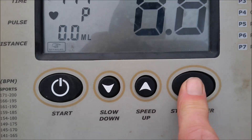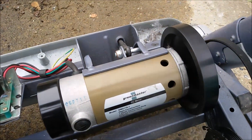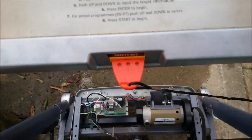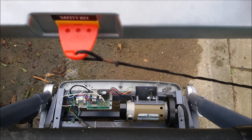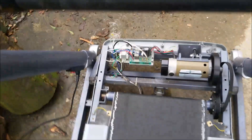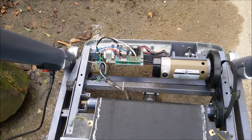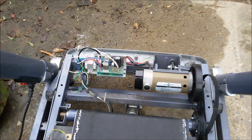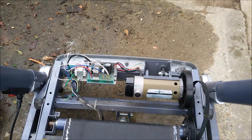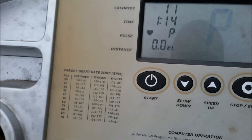You won't be able to hear the incline motor when that's on, so let's stop and slow that down. And then there's the incline motor. Well actually, I can't tell much incline. You know what I've done — in reconnecting the wires, I have in fact put the incline wires back to front. The incline motor is working fine, and I don't need it. But there's a pulse meter on there as well — heart rate.